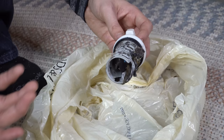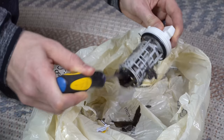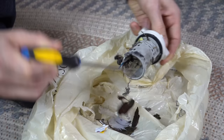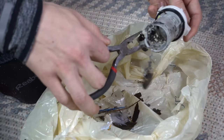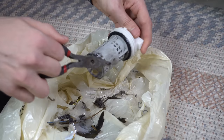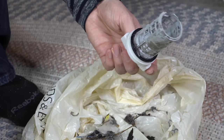This one's not completely plugged — actually not that bad. I've seen some that are completely clogged, especially when someone washes a rubber-backed rug. Those little rubber balls on the bottom come off and end up inside the drain pump filter and all over the hoses inside the washer. Once you have the filter out, clean all that gunk out. Use rubber gloves if you have them, or needle nose pliers and a screwdriver to scrub it out. I once went to a barber's house where the filter was completely caked with hair, and inside was a neat roll of dollar bills and five dollar bills — the only time I've ever seen a filter full of money.